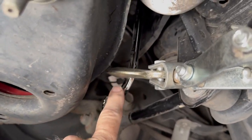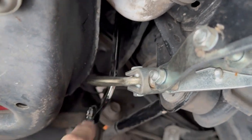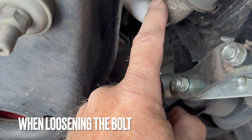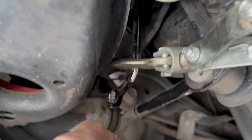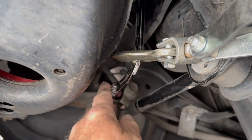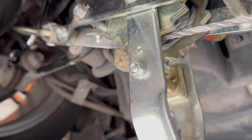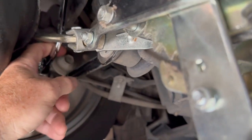I have a 17 millimeter wrench on the nut, and this is an S-shaped wrench. I was able to find this at Harbor Freight, and it's the only one I could find that actually gets around the metal lip that's around the nut and falls into the gap. Now, I want you to know, I was literally hanging on this and it still didn't break it loose. That sucker's on there. So I have this come along, and I was trying to think of a way that I could use it to get some tension and pull on this wrench.